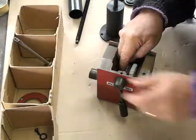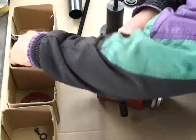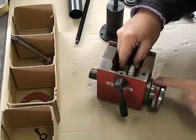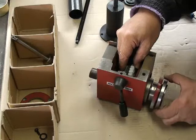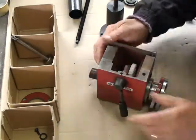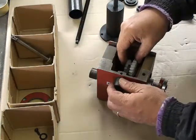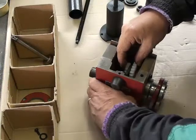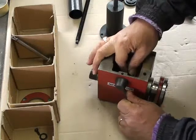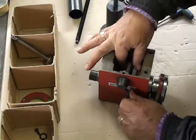The shaft will go in that box there. There's a small circlip here which I've taken off. That came out this way on the flange side, and it's left a little bearing at the other end. So now I can remove the shifter fork — it's all a little bit tight in here, and it's come out.